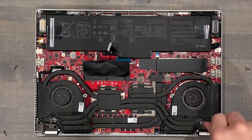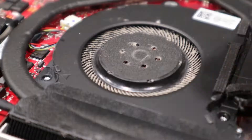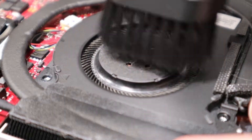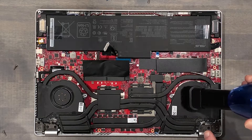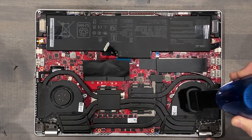This is where many rush their work and strip screws. Having the right tools is just as important as the right mindset — be patient and correct with your work. Next, remove the two screws from each fan. The fans are dusty and this hasn't been cleaned in eight months, so now's a good time to use a handheld vacuum. If you use compressed air, do not let the fan spin under it — that's too fast for the bearing and you'll prematurely wear it out.